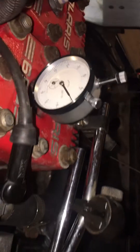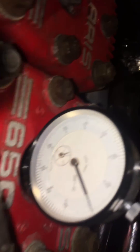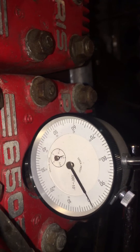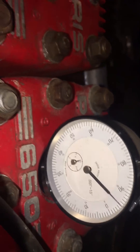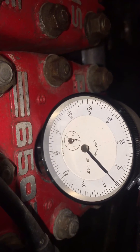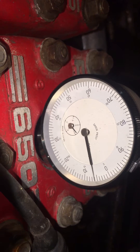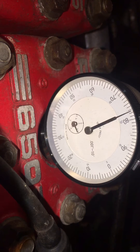Like I said, there's a spec in your book — this is 125 thousandths for 25 degrees. A hundred thousandths is one full revolution of the wheel. So we'll come back, turning your engine backwards now, back before top dead center — there's one rev — and we'll come back to 75.